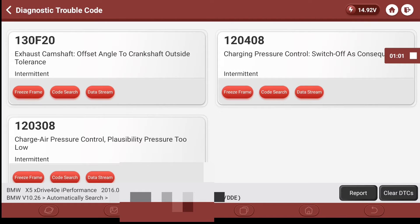One thing to emphasize — you should disconnect the vanos solenoids and put everything in a neutral position when scoping. In the reference example trace, everything was in a neutral position with disconnected vanos solenoids. Sometimes you'll have valve overlap for emissions reasons, so you need to minimize that when checking for chain stretch. Don't do what I did — make sure you disconnect those solenoids.